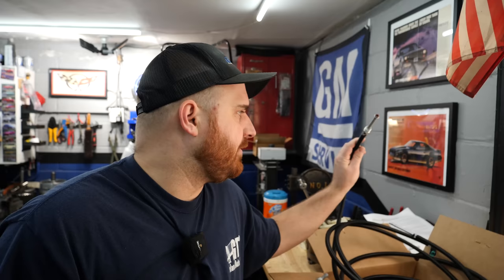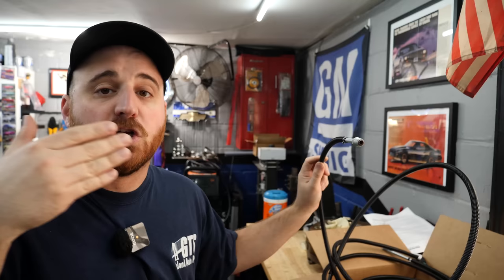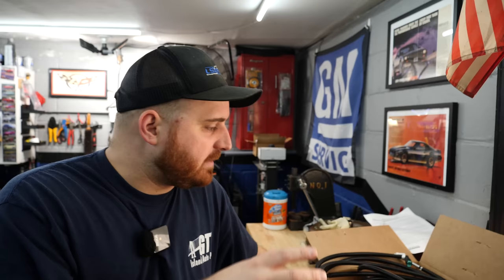The way these things are plumbed up, the factory fuel lines — you've got the hard line coming from the engine, runs down the transmission tunnel, and then it plugs into what are basically hoses that come off the fuel pump itself. The fuel pump is in the middle of the tank, so you have just hose coming off of it, and then it makes the connection to the hard lines at the end of the tank. So you don't even have to drop the fuel tank to change these — you can get to those connections right at the end of the tank. I'm going to link these down below in case you guys want to check them out.